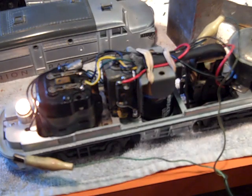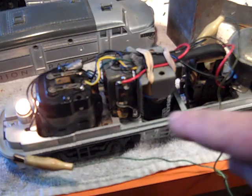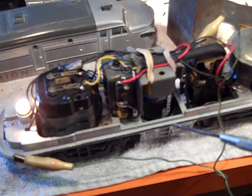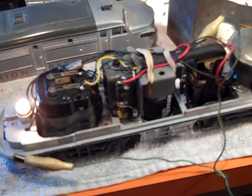After getting the whole thing together and trying it with the transformer, I found the horn relay was sticking and wouldn't shut off — actually one of the worst ones I've seen. The easy fix: I took a little section of black electrical tape and stuck it on the bottom of the movable armature contact. This prevents the armature contact from sticking magnetically to the coil core. It doesn't really interfere with the operation of the horn or the relay, it's a quick and easy fix that works pretty well. Now it cycles reliably, the horn sounds good — I'd call this whole thing a success. Thanks for watching again.